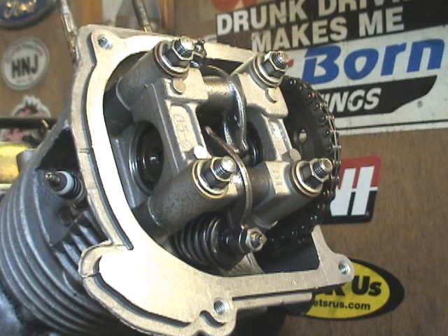If you use a higher setting and you hear a lot of tapping, you probably need to go down a little bit. For instance, if you use four thousandths and it taps like crazy, you might want to try using three thousandths of an inch.